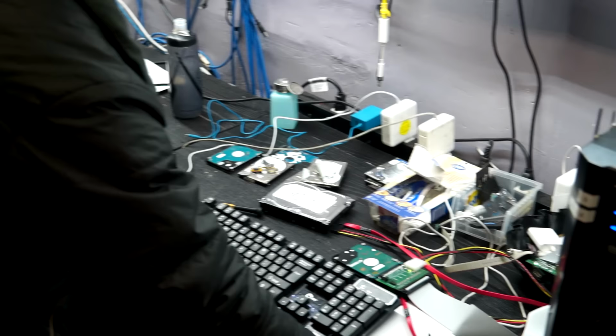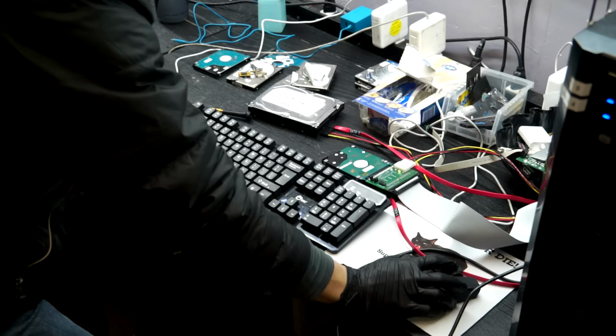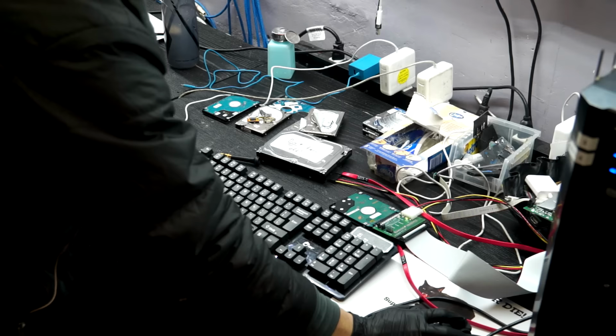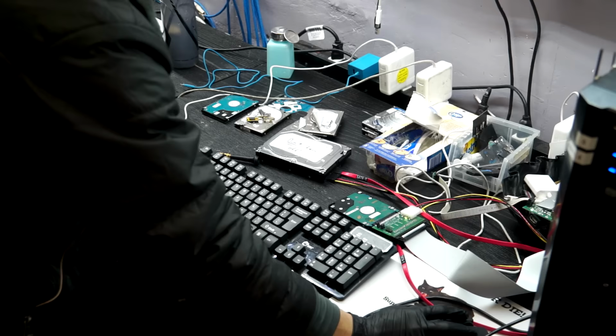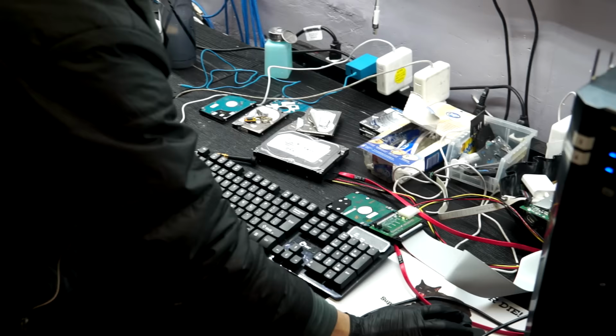Yeah, let's first see if we can get access to... Move the camera out of the way in case there's anything that we don't want people to see there. Data privacy. So we're going to read the first sector first. Okay, first sector. And if we can read the last sector, theoretically, we should have access to everything in between. So there's the last sector. So now we can go ahead and minimize this and start up data extractor.